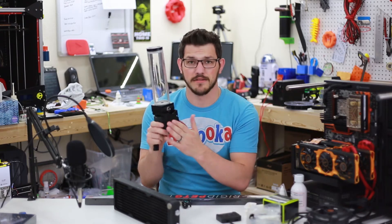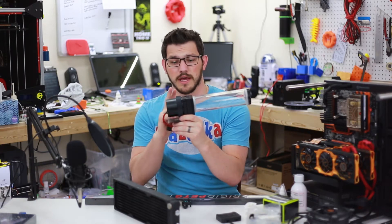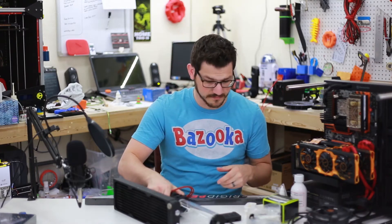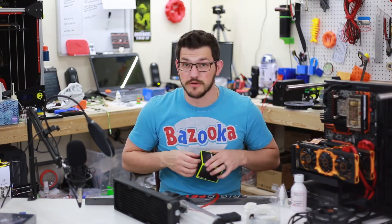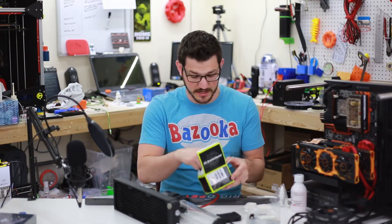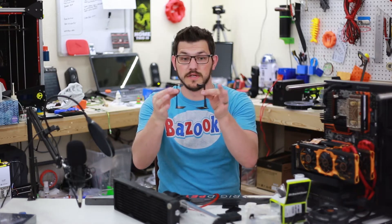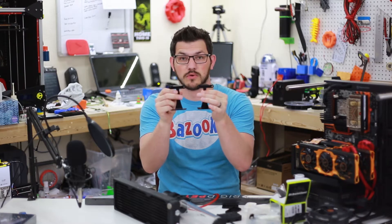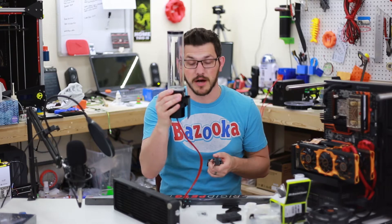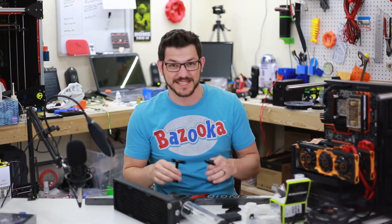The main thing was I had this bracket here — it holds your reservoir and pump combo like this. That's not going to work on this PC so I went ahead and picked up a new D5 bracket. This is a D5 pump, one of the two main types that are out there. These are vertical brackets with a horizontal crossbar to go on and hold the pump upright. I'm really hoping the spacing is correct, but let's get that together and find out.